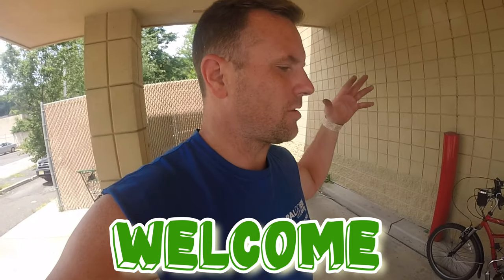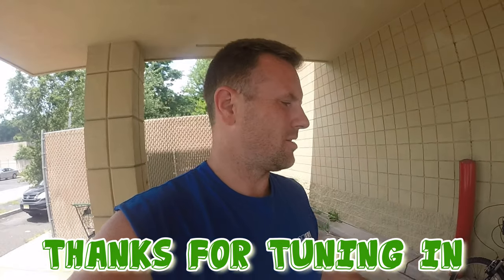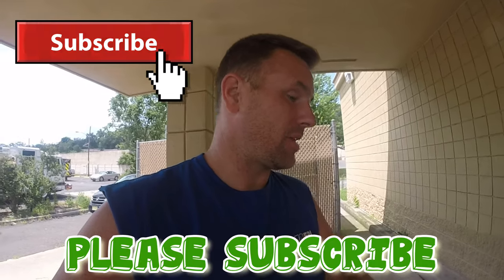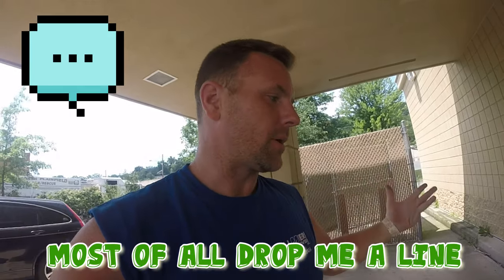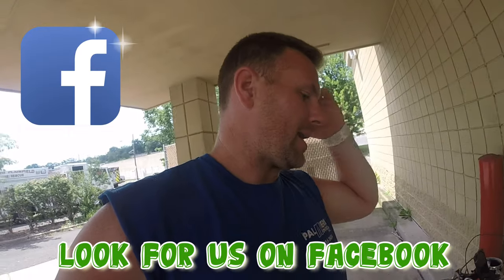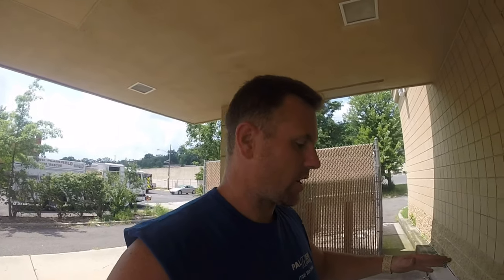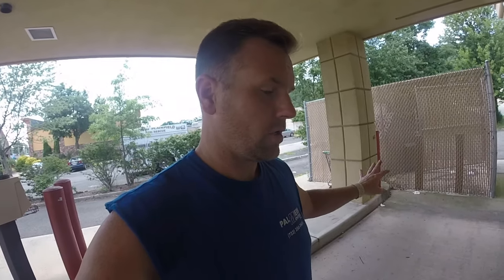Welcome back to the channel. I'm excited about this one - definitely comment on how it's going. I spent the past six or seven days working on this motor. I took the YD100 and I'm doing the Dio-Reed setup like I've been wanting to do from the very beginning, the first time I bought the motor from Go Max. I bought the Dio-Reed setup also from Go Max, but the circlip broke, destroyed the cylinder, and I had the motor sitting for a long time. I really love the YD100 platform - it's a great platform out of the box, just more power.